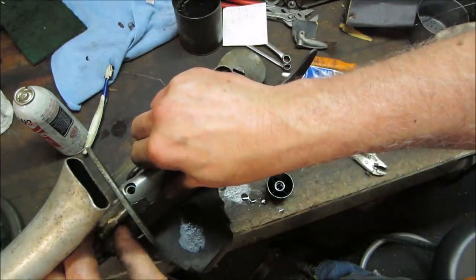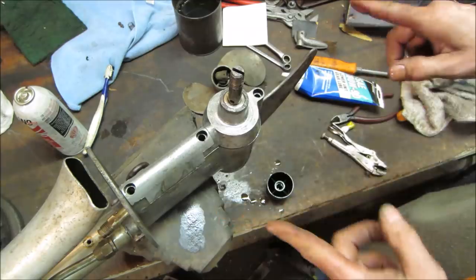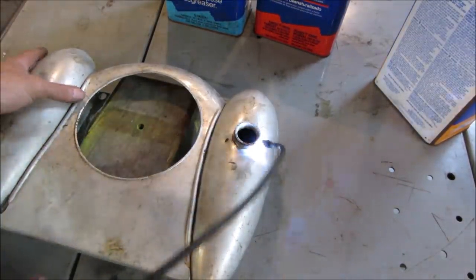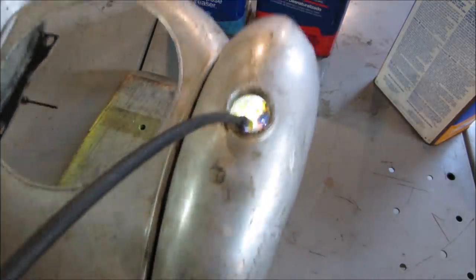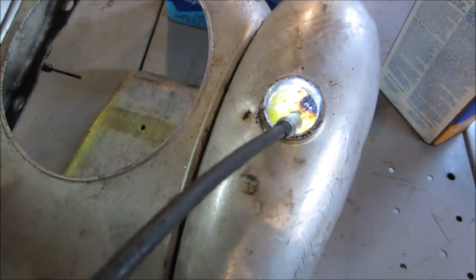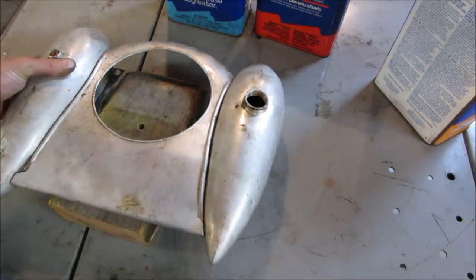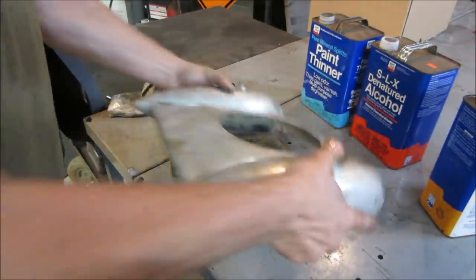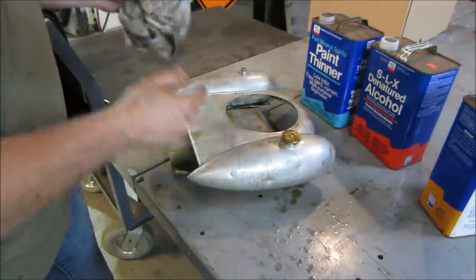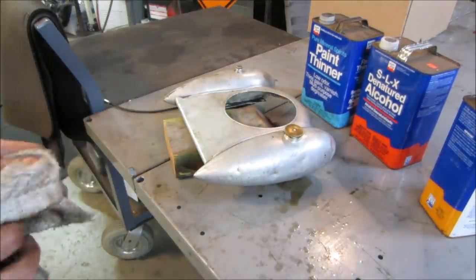And this tube goes in the side. I gotta tighten that up. I'm gonna get all the hardware, screw that together. See how our lacquer thinner's doing. Actually, that looks pretty good. It's like melting it. Yeah, that's rinsing it away pretty good. I'm gonna put some more in there so it kind of flows over the other side. I have half a mind to tie it to the wheel in the car outside and let her spin around, but we're gonna let that soak out, see if we can get rid of that sludge while we're doing other stuff. And all I gotta do is every once in a while come by and do that. Even cleans the outside. And hopefully that'll get rid of all the goo.